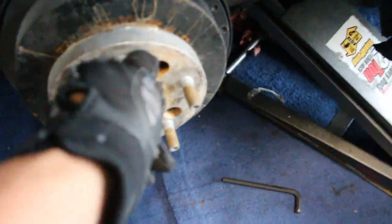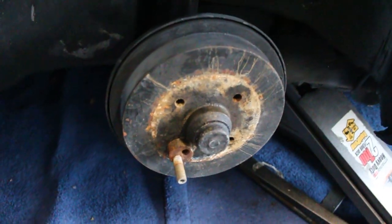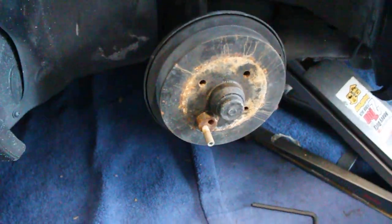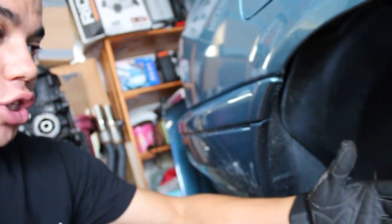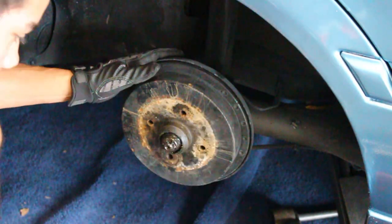Got the hub moving. Now we're in progress. Once your center cap here is off, there's gonna be a small little cotter pin you want to pull out. After that there are a few little cap things - just pull it straight off. You get to a 15/16th nut - undo that, and once that is off, your whole entire hub assembly should slide straight off.